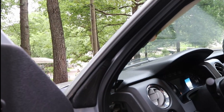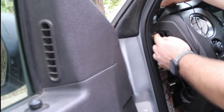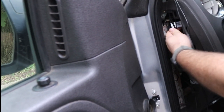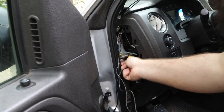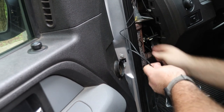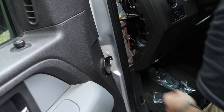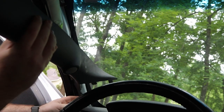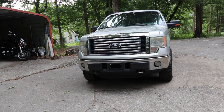Now we're just going to take both of our lines and stick them through up here so they're behind the A-pillar, and as they come down through here we'll catch them. Route them over and under anything needed so we can get them to the radio. I'm not installing the radio just yet, so I'll leave it like this until I'm ready. Now take your tweeter wire and stick it through, line up your A-pillar, and that's all there is to it. If you found this video helpful, please leave a like, comment, share, and subscribe — thank you.